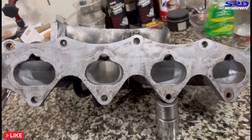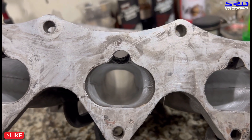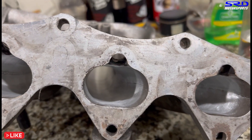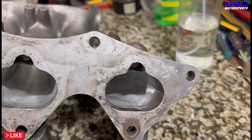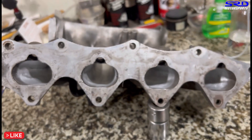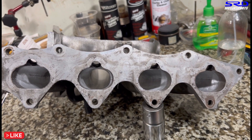And look at the flange side here — it's ported through and through. We'll always leave the last inch before the flange untouched. This way we can actually port match this to the head really well when the head is done or whichever head we decide to use. Since this is going to be B20 VTEC, it's going to be good when the head is ready.